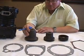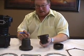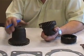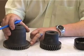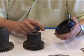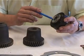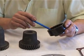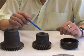The drive gear is another consideration. Most drive gears on compressors today are steel, and it's a good idea to inspect the teeth carefully. The majority of steel gears are reusable if inspected — unless they have a chip or too much wear, in which case they need to be replaced. Some drive gears are made of a fiber-like material, and these are not reusable. The steel portion will separate from the fiber over time, so if you have a fiber gear, do not reuse it. Only steel gears should be reused.